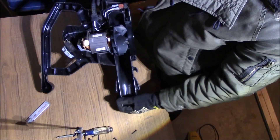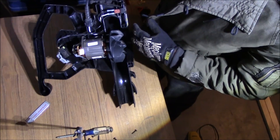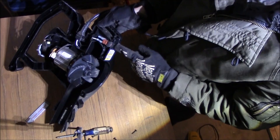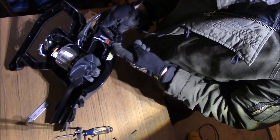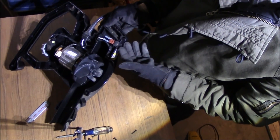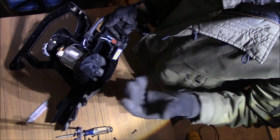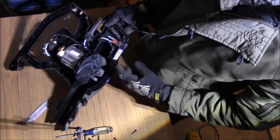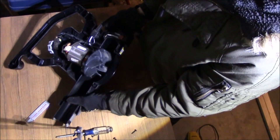One thing I don't notice is that the bottom — not counting the issue I'm likely having — there's a button right here at the bottom of the blower which the bottom plastic part hits. It connects and it's like a safety switch. I was sort of hoping that was the case because then I could just bypass it. But maybe something to be aware of if you lost the plastic part or the plastic nub broke off — it could just be a safety switch if yours isn't working.